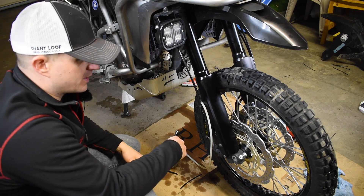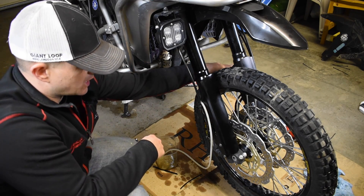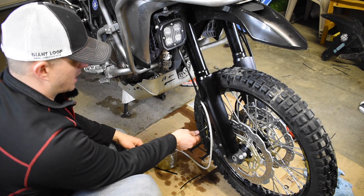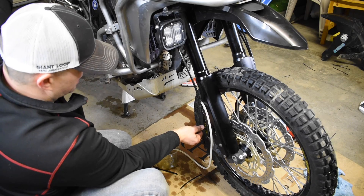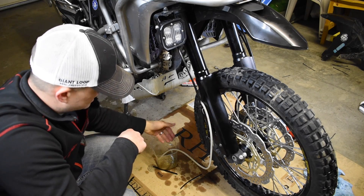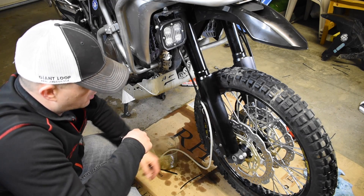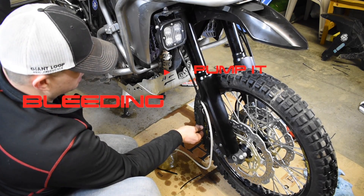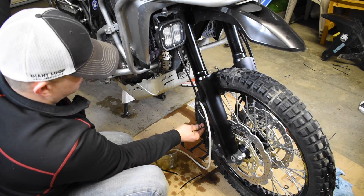Now all we're doing is bleeding the brake lines. You have your bleeder valves on each side. I did this other side first just because it's first in line, and once that one doesn't have any more bubbles I moved to the other side. All you do is press the front brake several times. I have a piece of hose attached going up and around and then down to my bucket — that allows fluid to go up once you bleed it and doesn't allow air bubbles to go back in if you accidentally release it. Give it a few pumps — about four or five — bleed it, tighten it back up, and repeat the process.